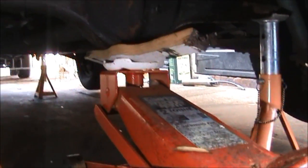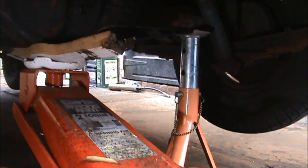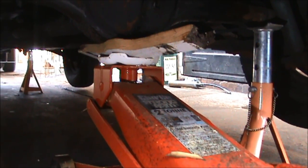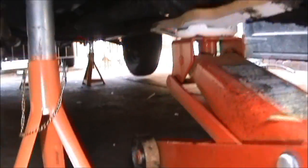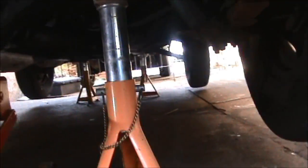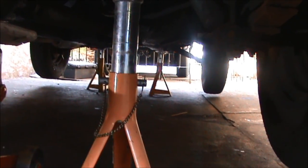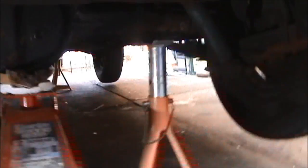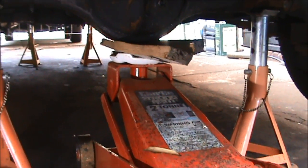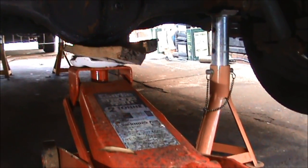You can see you need to go up a little bit more to get the stands underneath. You can see also that the wheels are very clearly off the ground, which is good. One rule you should never do is to go underneath a car when it is just on a jack — it's rule number one, you just don't do it, it's not safe. I'll put these stands in now — just putting them in from the back because I can just about reach. Once it's back down on the floor, quite happily and safely I'll be able to work on the car. Just very slowly ease the jack back and it should drop down — you can see the weight's taken off the jack. I'll leave the jack in place because the back end is going to come back down first later on.